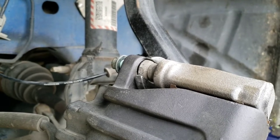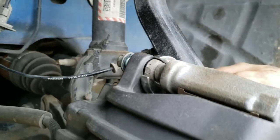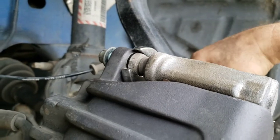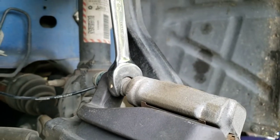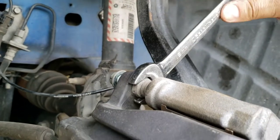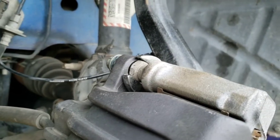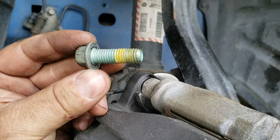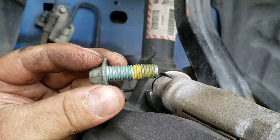These are really tight too. This is a half inch and you've got to hold this in place because the whole thing turns, so you can't get your pin out — I've also never seen that before. Usually you just unbolt the pin and pull it out, but this one you've got to lock here. The cool part is it's an 18mm, which most toolkits do not include. So you've got a half inch here and 18mm on here — you've got to hold that still while you break it loose, or the whole thing spins and you can't get it out. And that would be why this one was tight too — not only does it have green crap on there, but you can also see that yellow goop on there.